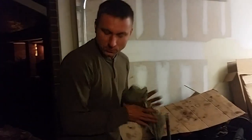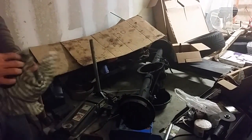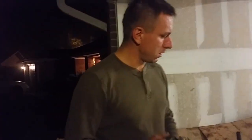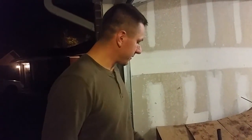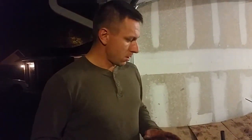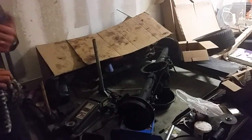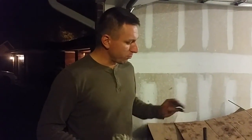Hi there, this is Perry Mason. Today is one of the more useful videos I've been promising you guys for a while. I know a couple of you guys have been asking. This is a 12 bolt that I got for $280 — it had 2.73 gears and drum brakes. I am putting it in my '67 GTO clone. I bought 2.56 gears for it, and I bought these brakes off an LS1 Camaro 1998–2002. I will show you step-by-step exactly how to put LS1 Camaro brakes on the back of any GM rear end — be it an S10, be it your 80s Camaro, be it a Firebird, a 68 Camaro, a 10 bolt, or 12 bolt. As long as it's a passenger car or small truck rear end, it doesn't matter — the actual brake flanges are the same.